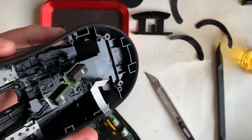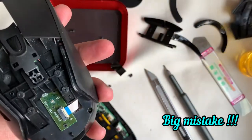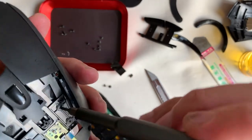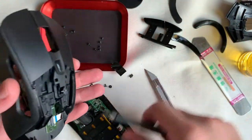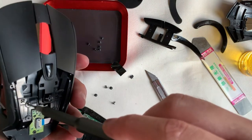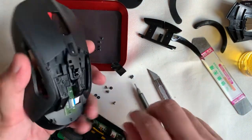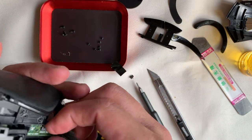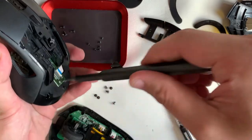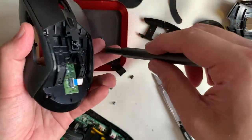After searching for around 15 minutes for why the top was still attached, I tried prying it open and the plastic part broke. We'll just use some super glue to stick it and hopefully it adheres well. For this mouse, the left and right panels are designed differently and can be replaced individually — maybe in case a frustrated gamer throws and breaks it. The other end of the ribbon cable: just flip it up and safely remove it. The secondary board that controls or connects all the buttons can be removed with two Phillips screws.